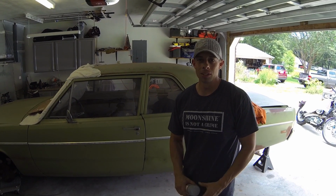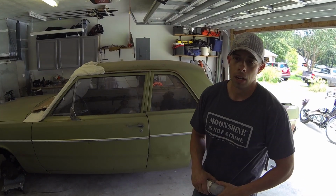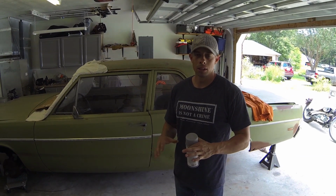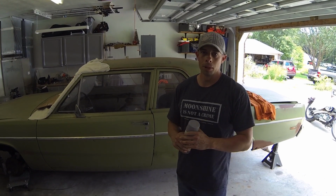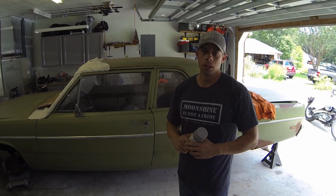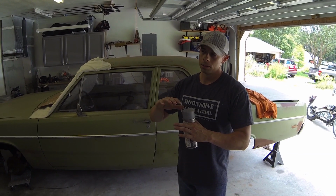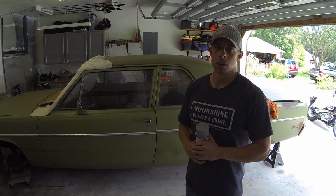Alright guys, welcome back. This is video 2 on the spring relocate kit on the 69 Valiant. I already got everything cut away in the last video and spring hangers kind of mocked up in place for now. I'm going to have to take them back off, put some weld-through primer underneath, that way nothing that we can't get to later to paint will rust, and then we can weld all of our stuff up.